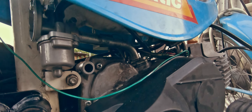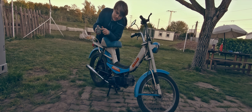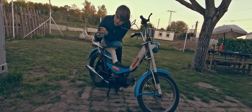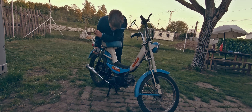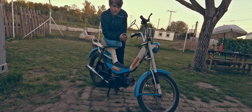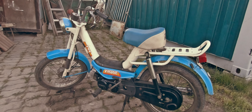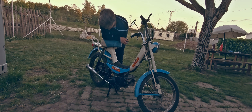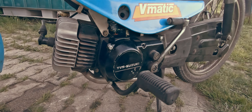What am I going to do? I'm going to make a custom intake manifold which I can mount a Dellorto carb onto. Why can't I do that right now? Well, step one — this is a smaller diameter than what the Dellorto carbs have. Also the frame clearance: the original carb clears the frame because half of it is missing, but a normal carb doesn't. So: custom intake manifold, put a nice carb on there, and she's ready to roll. Maybe I'll also check or replace the reeds, as I suspect that could be part of the problem.